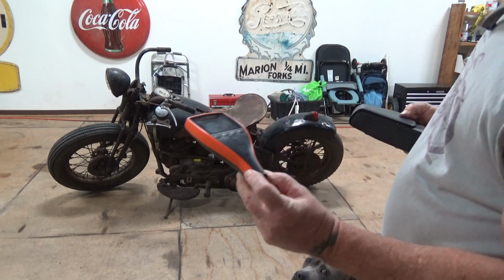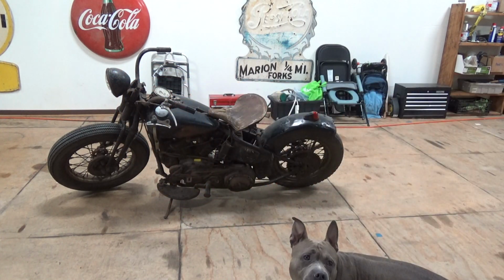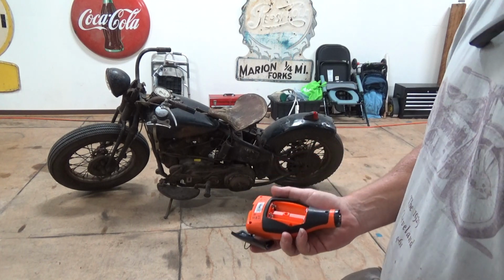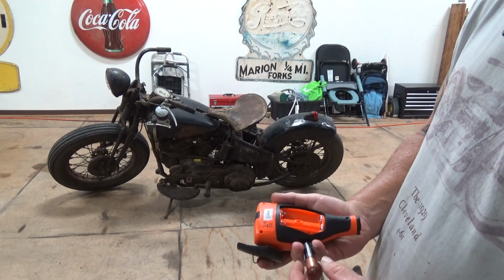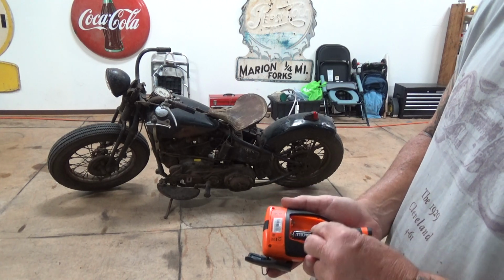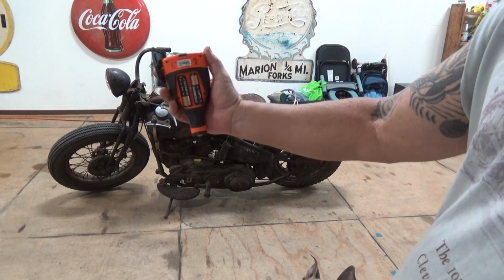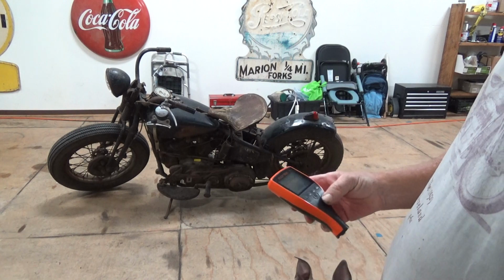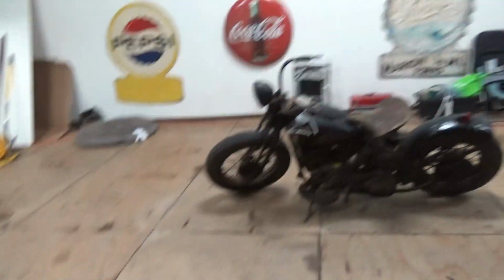So if you get one of these little meters, elcometer.com, they're about $600-700. And it doesn't tell you for sure it's original paint. What it tells you is for sure it's not, because it tells you the depth. So if it's too thick, we know it's not Harley paint. Follow me? And always save them in storage with the batteries out, because the batteries corrode, and there goes your meter. So let's take the camera and we're going to find out what's what.